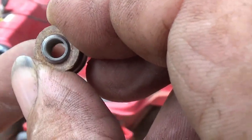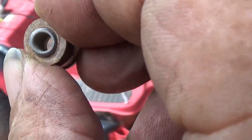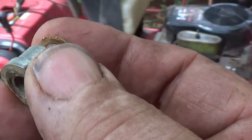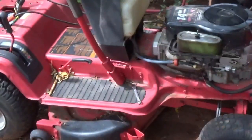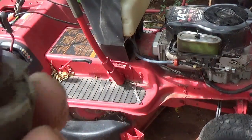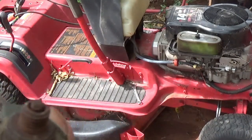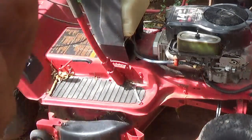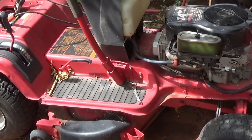What I could do is grind this down — though it looks pretty bad anyway. Or I could get some JB Weld and pack it up in there to seal it off, since there really shouldn't be any pressure. That would stop it from leaking and it may work. But I may just go ahead and take this to the wire wheel, clean it up, grind that nub down, put it on there, and see if it'll run and stop leaking. I'll be back in a couple of minutes.